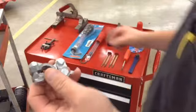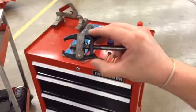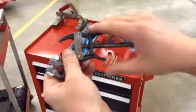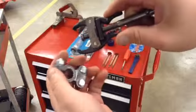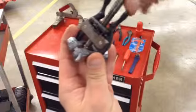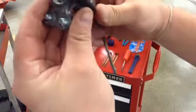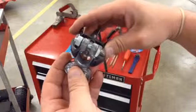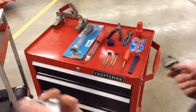So what you should do is use this gizmo right here. All right, and this is just a puller, battery terminal puller. And how that will work is, I'll just unthread it a bit. And of course, with the nut loose on that connection, this part goes right on top of the terminal, slip it over top, and as you turn, what's happening is this threaded part is pushing down on the battery terminal, and the little claws down here grip it from underneath, so it's going to push and pull at the same time, and this will properly remove your battery terminal without damaging it.